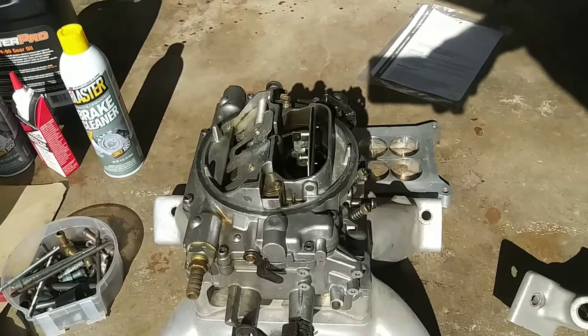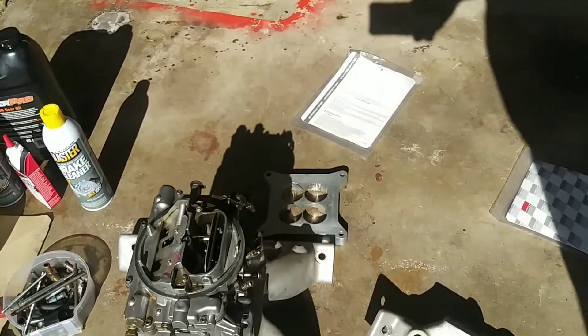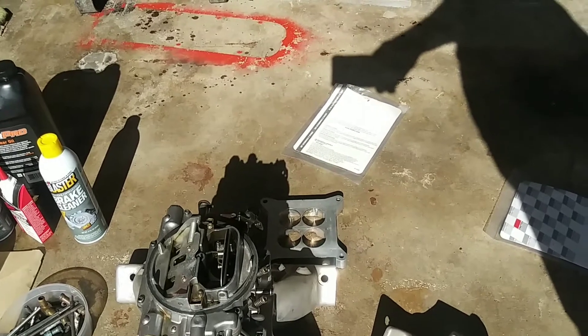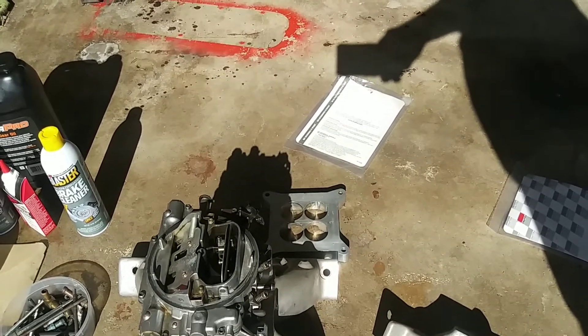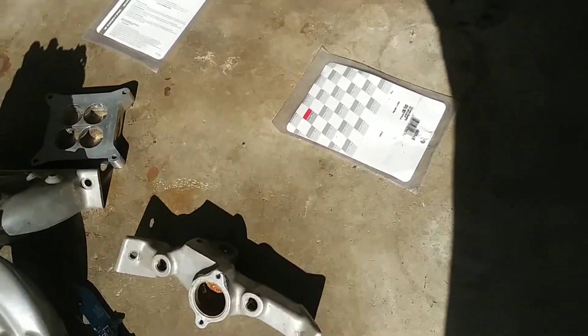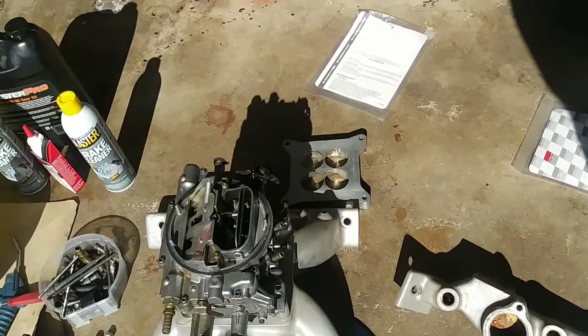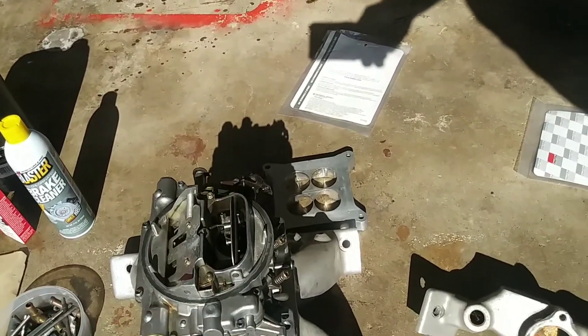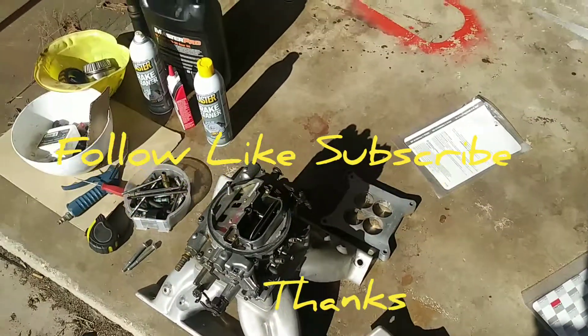So stay tuned — we'll stick this on top, because the carb's already off on the other manifold. We'll just do a quick manifold swap, because the water crossover is separated, so I don't break into the water. I can just lift off the blue Felpro gasket and it'll release and go right back on. That one man garage.